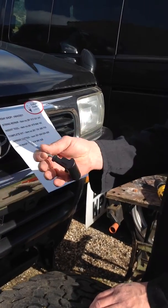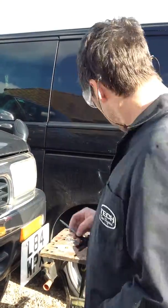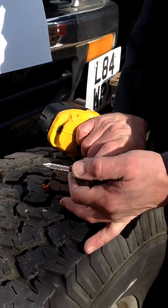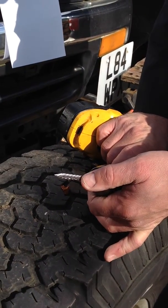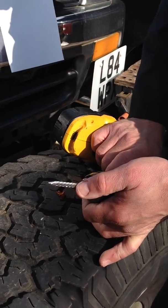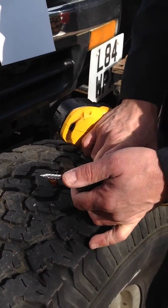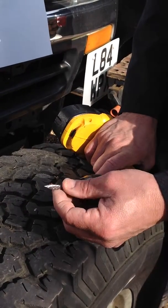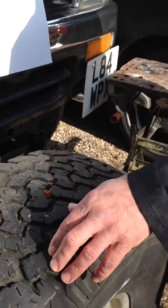That's the hand rasp. These are great, but to be honest they don't last long, they're just high-speed steel. This thing, however, this carbide cutter, I've never ever seen one wear out. That will ream out literally hundreds if not thousands of injuries. They're expensive, they're very hard. If you drop that on the floor you can actually break the tip off, but again they last forever, so if you look after it you've got a tool for life.